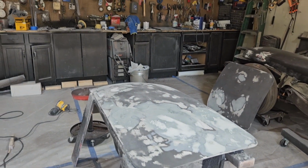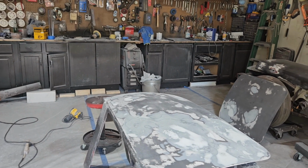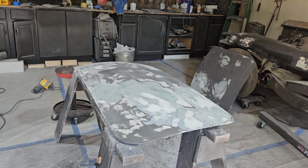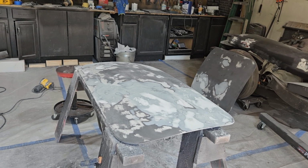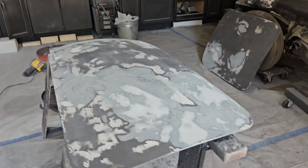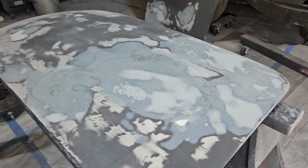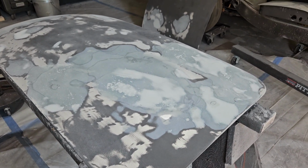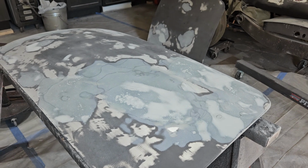I'm gonna epoxy prime one layer and let it sit and kind of soak into the fiberglass and the little bit of Bondo that you see there. Bondo, if you're so curious, look for the lighter color. The darker green is the fiberglass. The lighter stuff is the Bondo. So there's not much Bondo. A lot of fiberglass. Fiberglass will soak in epoxy primer, so will Bondo.